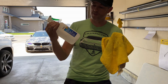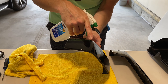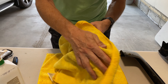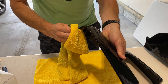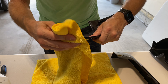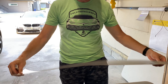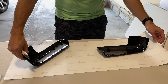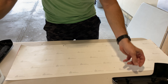Time to clean these properly — 70% isopropyl alcohol. Mine still have PPF on them, which I'm going to keep there, and we'll just wrap right over top. You want to get these good and clean, as well as the inside edges because our vinyl is going to curve over the edge this time. Whereas when I wrapped them on the vehicle, I wasn't able to curl the vinyl under very well because they were still attached. I'm just going to cut this one piece that I already have — it is going to have to curve around the edge, but we can work it at an angle. I'm not too worried, so I'm just going to cut this right down the middle.